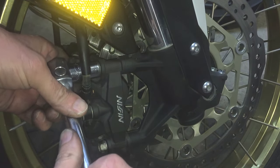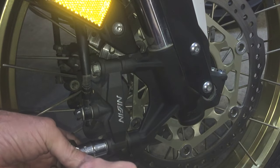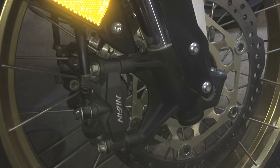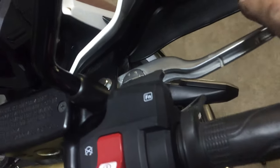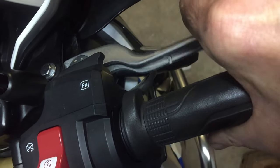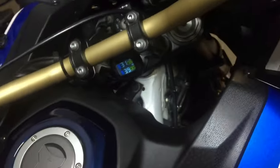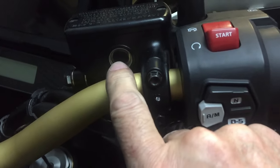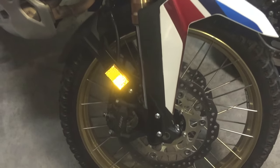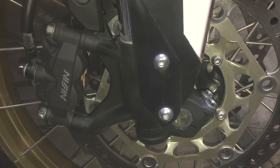I'm not using a torque wrench — well, I'm using the torque wrench in my elbow, it's never failed me yet. Of course I do the exact same thing for the other caliper but I won't bore you by showing you that. Now the last and very most important thing is to pump those pistons back out so that the next time I grab a handful of brake, the brake actually works. There we go — nice and firm, jobs done. I just make sure that the fluid level's still up — it's all good. Jobs done, you've watched the process in real time — six minutes for each side. Thanks for watching, catch you next time.